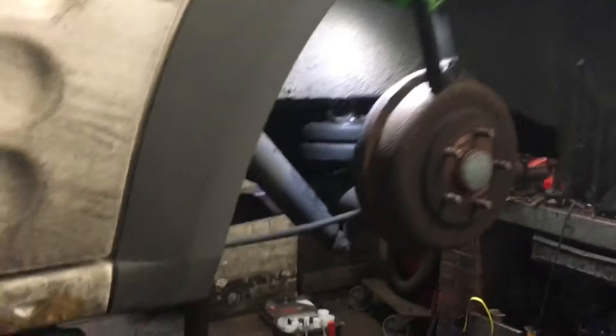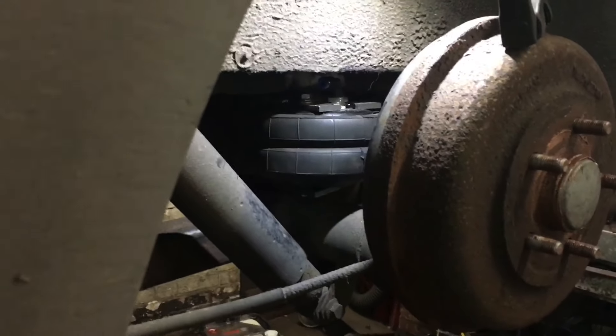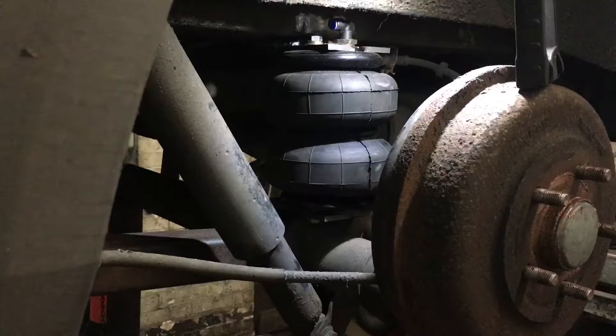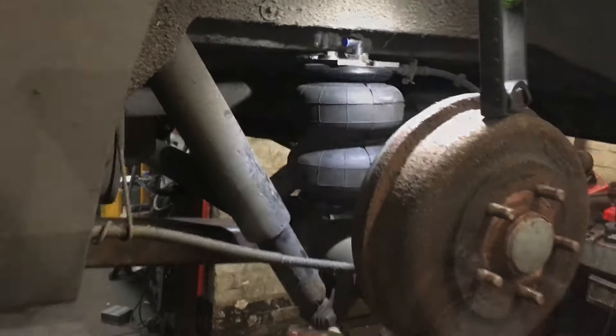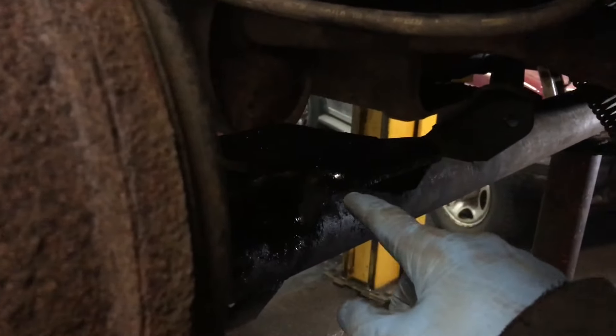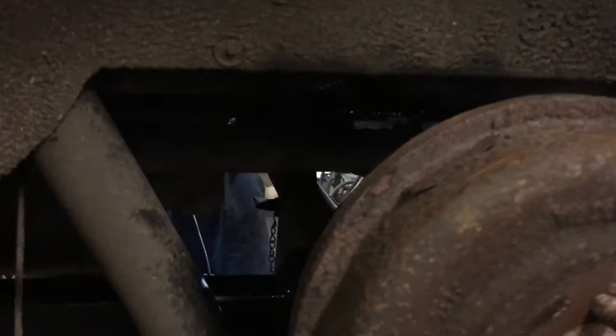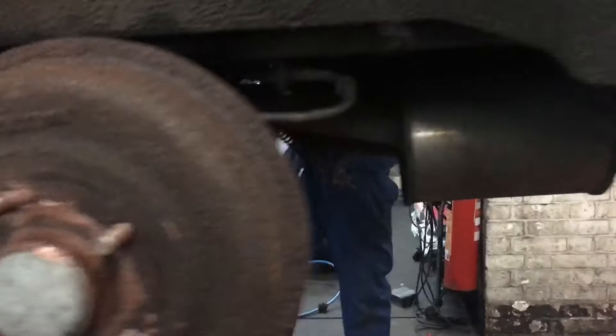That's as low as it's going to go. I think this is going to work personally. We welded the bottom plate to the beam and the top plate to the chassis leg, gave it a quick coat of satin/matte black, and painted all the little trailing arm things we made. Now we just need to bolt it all together and run some lines. This is so going to work.